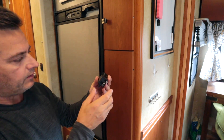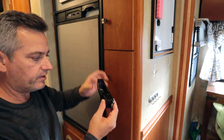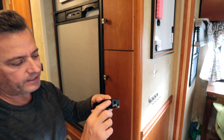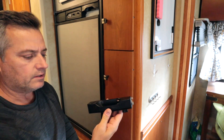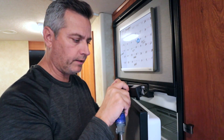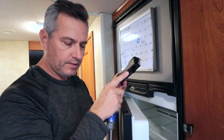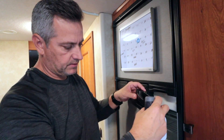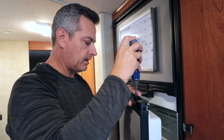Here's the door handle. One thing I noticed over time — if anything leaks out of the freezer and drips onto the refrigerator door handle, this will kind of stick, which ours was doing. Just wash it in some warm soapy water and it should be good to go. We've got the handle all cleaned up and it moves freely now. Reinstallation is simple — there's a tab on the handle and a slot on the door, they just line up and it slides right into place. Then two Phillips head screws secure it back on the door frame.